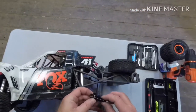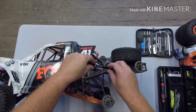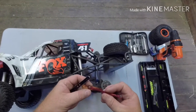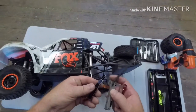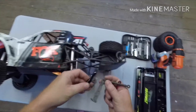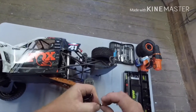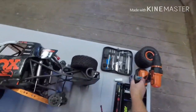Let's make sure we get the right sides — obviously Hot Racing label pointing up, as it's going to rest on here when it's all said and done. There's no writing on the brackets so they look like they're going the same direction. There are a couple of different settings, so I'm just going to line it up and see where it would have been originally — looks like they would have been in about the middle holes, so that's what I'm going with. Washer, then Loctite on all the fasteners.